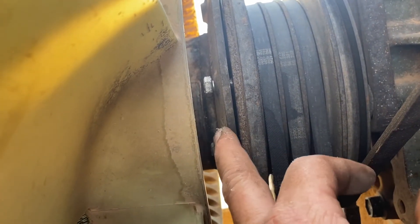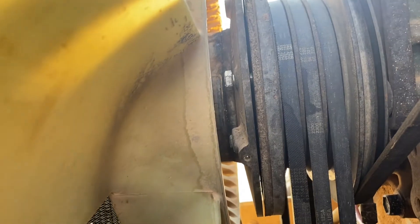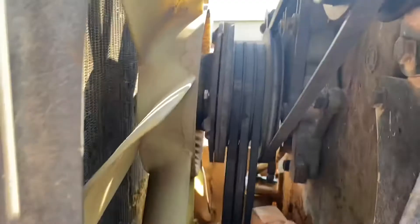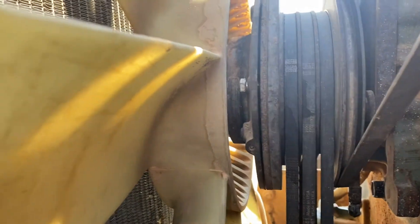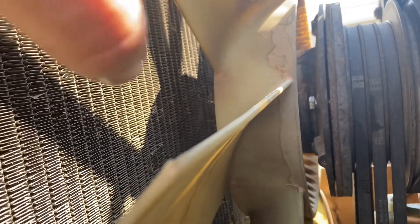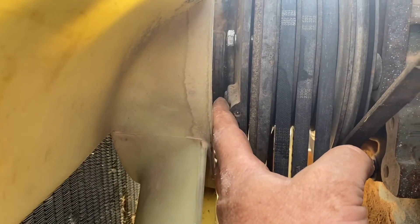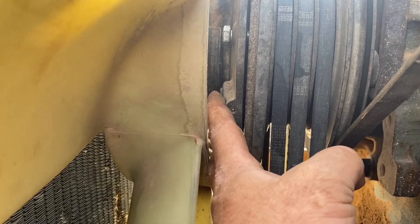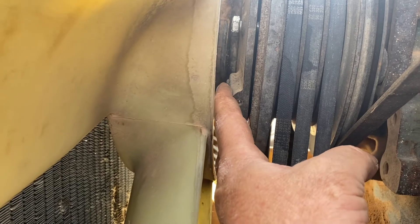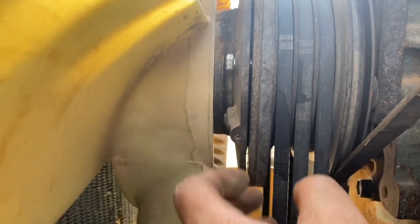I felt around and in this piece there is a hole or a notch that bolt fits into and locks the hub out — so that was our fix for the day. We've got the fan locked out so we can run until we get our parts. You've got about two and a half inches to work with in here, just enough to get a 3/8 ratchet in there and get your fan bolts off. If you're looking to lock one of these out, be careful — if the locking bolt doesn't work for you, you can tap out the hole next to it and put a 7/16 bolt in there to lock your hub out.